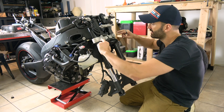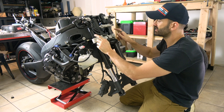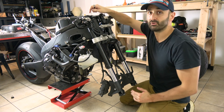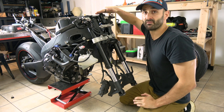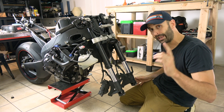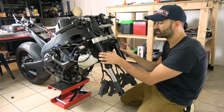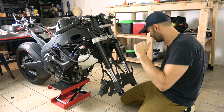The first thing we're going to tighten is the lower triple clamp right here, because right now those tubes can spin in those clamps. Before the video, I made sure the height on those tubes is correct - it's the same for both. I make sure it's equal by looking at the top of the tube right here, not the cap, and making it flush with the top of the upper triple clamp. I did that for both tubes, so now I know both tubes are at the same height, which is going to help a ton when putting the wheel axle through both legs.